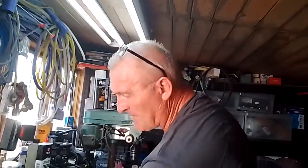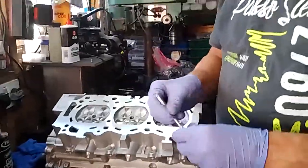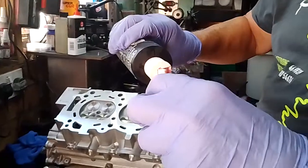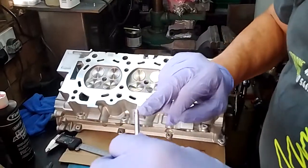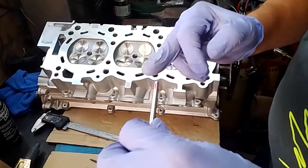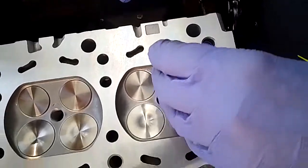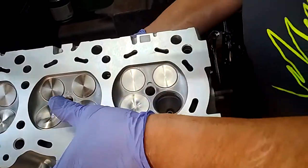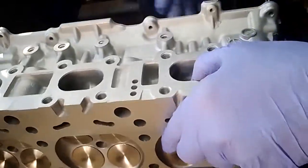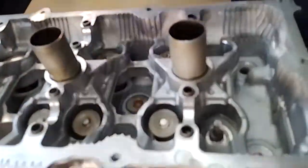If you're running standard camshafts they're probably all going to be fine, so these checks are worth doing but I'd be quite surprised if you find a big problem. Last couple of valves - I've actually weighed these and they're about five grams lighter than the originals. What I do - and everybody has their own way - is put a little bit of assembly lube around the top. Not only does it put a bit of lubricant down the valve guide, but when I put the collets on it will also stop them falling off.